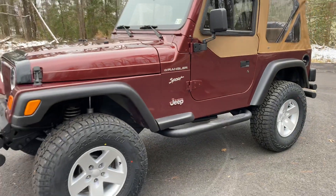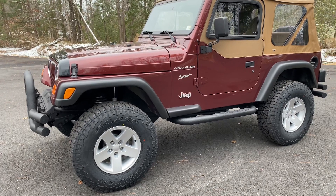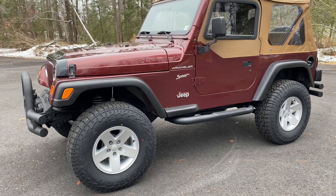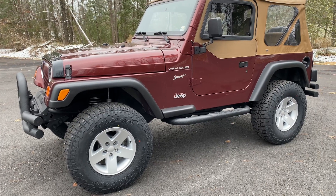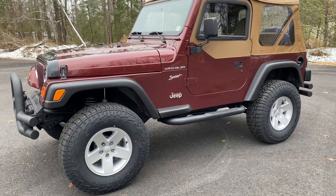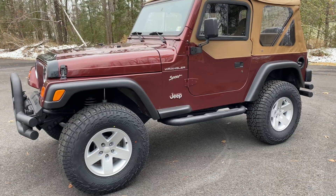That is a thorough process that gets done — it's very tedious and the end result nets you beautiful paint. Paint correction doesn't apply any new paint on the vehicle, so keep that in mind. It also doesn't do anything to dents or dings or anything that's through the clear coat or base coat. It essentially just refinishes the top clear coat, your top surface.